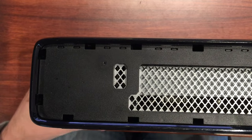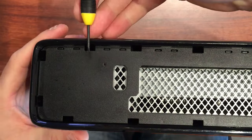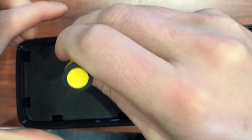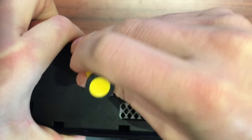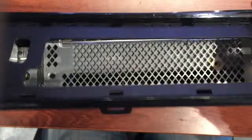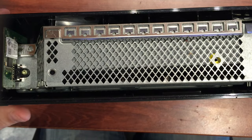To get this sort of insert out, there's different techniques. You can actually pop this tray and it breaks some tabs and it comes out, but I find that there's just six retaining clips — one here on the end, one in the middle, and one up this end, three on each side. So if you just put a fine screwdriver sort of down the hole there and wedge your finger under the lip and kind of lift up with some pressure, you can actually just pop the retaining clip out. Just keeping a bit of pressure on it, do another one on that side and do another one on that side, and then the whole thing will just come right out. You don't have to break it.